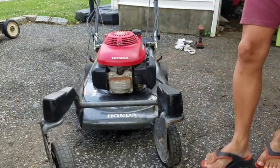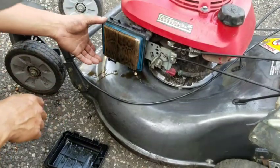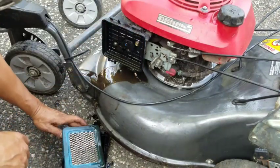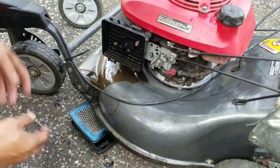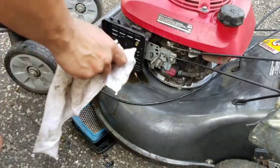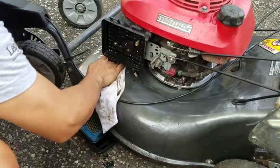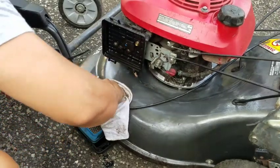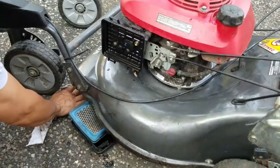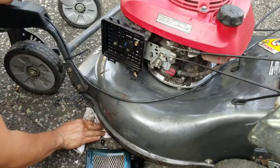Spray some liquid into the carburetor that I see. There's always a reason, fellas. No air was getting in there because there's just oil all over the place. Yeah, probably not going to start now. Shows the carburetor's filled with oil. If I have to take that carburetor apart again, I'm going to lose my brain. But being that's the case here, I almost have to think that the carburetor is filled with oil.